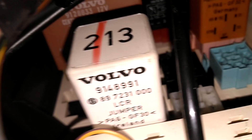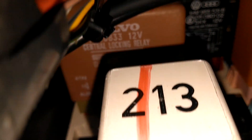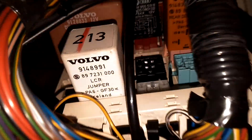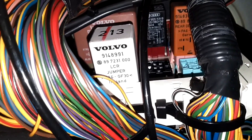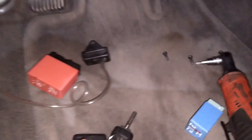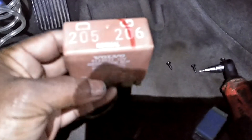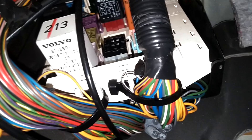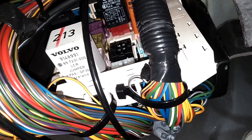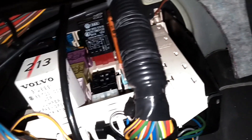If you look above where the anti-theft relay is, there's another brown relay labeled 'central locking relay.' I'm going to pull that relay and let you know what the number on it is so you'll know which one controls the central locking. This brown relay here is the central locking relay — it has 205/206 on it, and it's found under the dash. You'll see that white relay for the fog light; above that is relay 210-211 for your anti-theft. In the top socket next to that black relay, you'll find this relay for the central locking system.